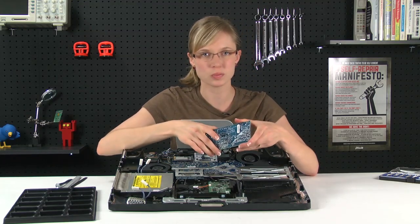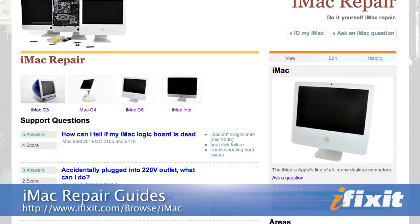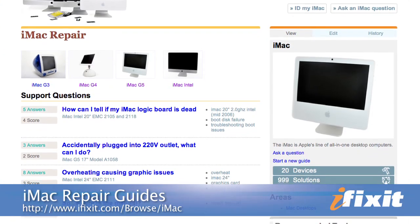All I have to do is reconnect my new power supply and put my iMac back together. A couple of notes on reassembly: don't forget to thoroughly clean both the LCD and the glass panel before you reinstall them — there's nothing worse than putting all those screws back in only to realize you've trapped fingerprints and dust on the inside. Also, before you put the bezel back on, don't forget to reconnect the microphone cable; it's really easy to rush through reassembly and totally skip that part. You can find all the parts and tools for this and many other repairs at iFixit.com, and if you run into any problems, there are lots of solutions in the iMac repair guide on our site. Thanks for watching and happy repairing!